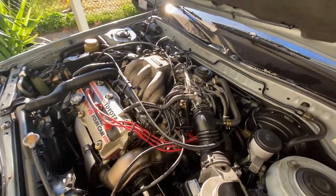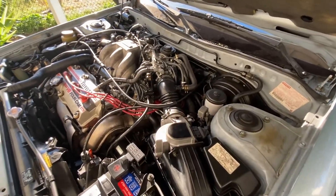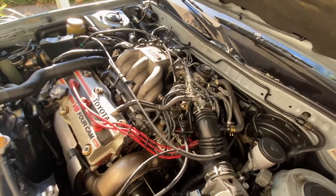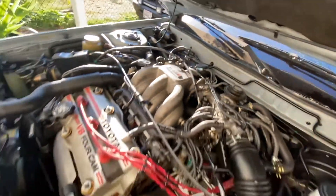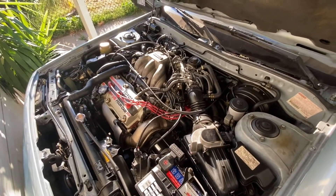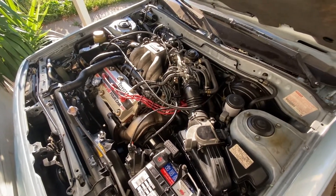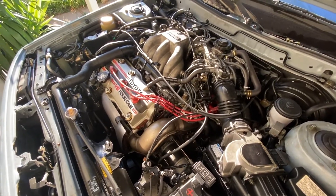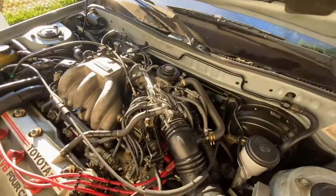Alright y'all, she's put back together again. This was a pain in the ass but altogether it wasn't that difficult — it was a lot easier than I thought it would be. I did run into some things that made it more time consuming, but as you can see everything is back together. Car sounds good now. As I showed in the clip earlier it was misfiring because the spark plugs — they were all pretty bad. I don't know when the last time the guy changed them, but I swapped those out and swapped the valve cover gasket.